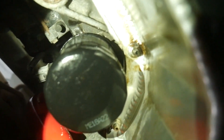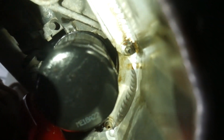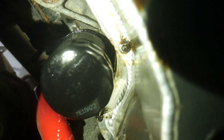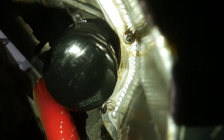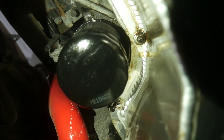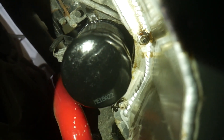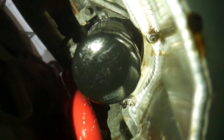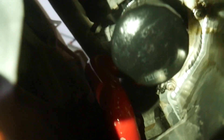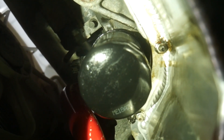Here's the filter — it looks pretty good. It is the perfect size from what I can tell for making a good seal so that oil doesn't leak out. Any larger in diameter and it's not going to seal. I need to figure out if there is a filter of this diameter but taller, which would be even better. Still, this is an upgrade over the stock oil filter — the stock ones on these cars are a little small. Oil is drained and filter is replaced, now we can fill in some new oil.